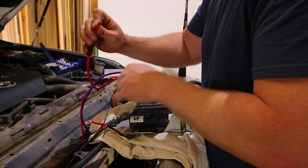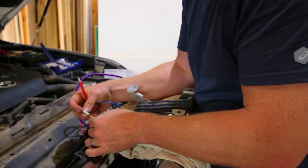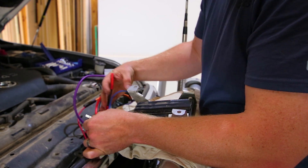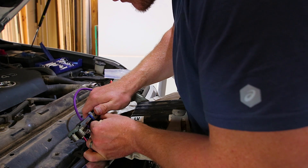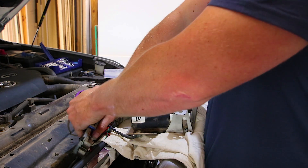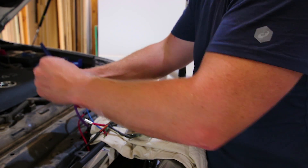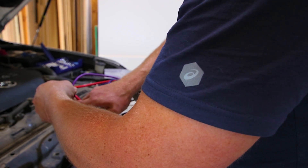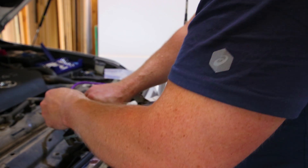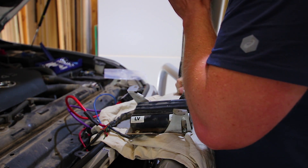The Redarc connectors are pretty easy to do. Essentially you've got a little collet — slip that over, do one at a time to keep it easy for yourself. There's a stopper in the middle so it stops where it wants to. Grab your proper crimpers — not your cheap nasty ones, get some proper ones. Crimp that on there. I've already slotted the heat shrink over. Slot that side in there, crimp again. I'm going to go through and do all the heat shrink later once it's all wired up.